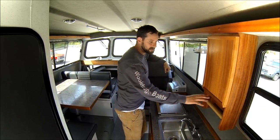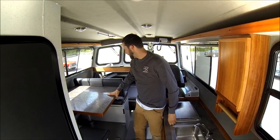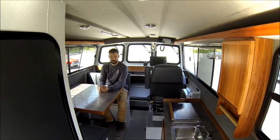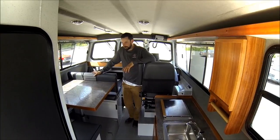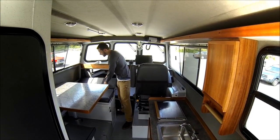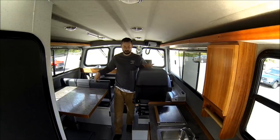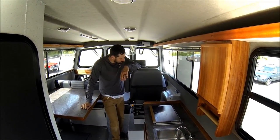He's got a nice little spice rack and paper towel holder cabinet, with a couple shelves and full-length trays up above. There's a nice dinette — about three foot by three foot table. The front has a flip-flop backrest, so you can face the table to eat, or flip it to face forward while running. One of the really neat things about this dinette is it turns into a very long bed — about seven feet — with the backrest dropping down, the table dropping on a gas shock, and a cushion going over top. He's also got an optional Bentley's Mariner suspension seat — adjustable height, slides forward and back, with shock adjustments and a pocket in the back.